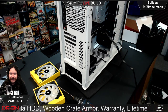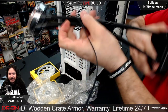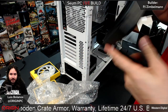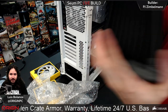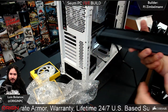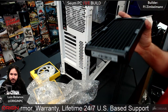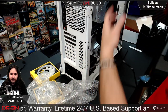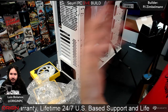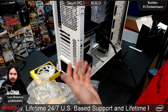The direction of the cooling? Well, it's the radiator itself. Okay, so PJ's going to help explain. So you see the pump? There's your heat sink. There's a liquid. It's all liquid cooled inside. If I'm shaking, if you can really get in here, you can actually hear the liquid moving around in here. So you can see the radiator right there, too. The idea is once you have the pump plugged in, the pump's going to cycle the liquid through the radiator itself. When you have the fans attached to it, depending on what setting you have on the computer, you can have the motherboard ramp up the fans to high speed when the system gains heat, like when you're playing a high-intensity game.